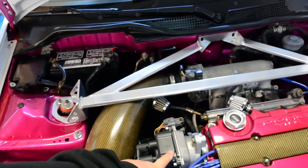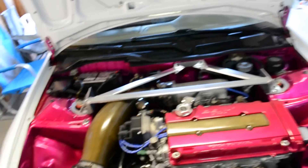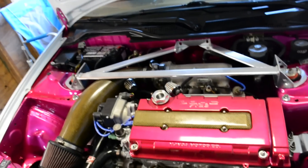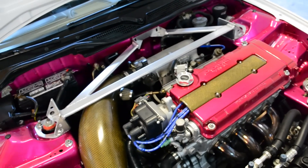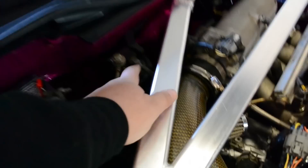Tuning your engine for the right setup is the best thing you can do for the longevity of your motor — a lot of people want to build a motor and have it last, and there's a lot of confusion out there. A couple of other tips to optimize your engine: NGK wires are very important. Cheap auto parts store wires tend to crap out very quickly. NGK plugs are also very important — Hondas are meant to run on those plugs. Don't go with anything else; Bosch plugs just don't really do well.